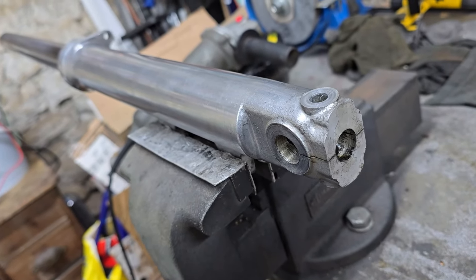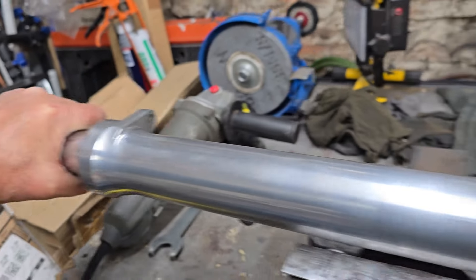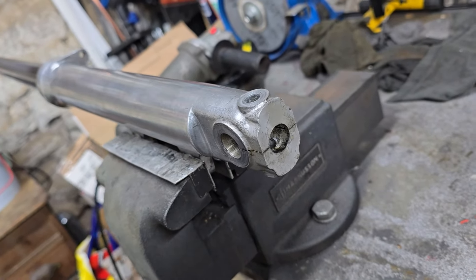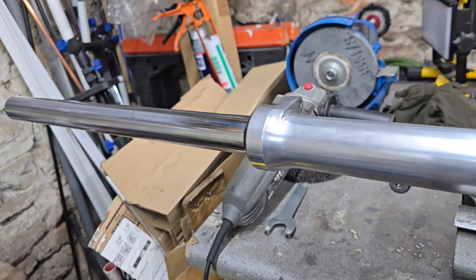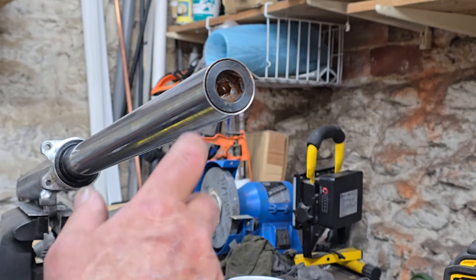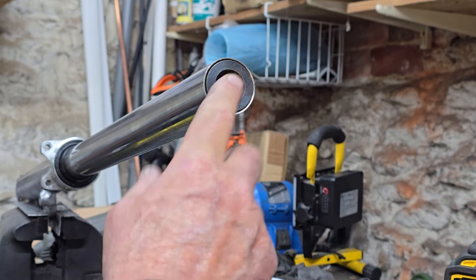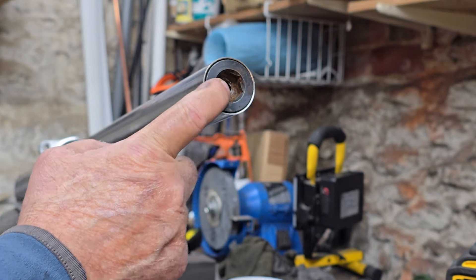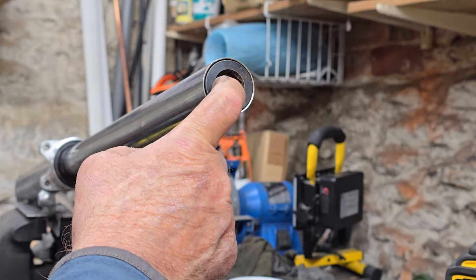In fact that's exactly what I've done with this one - I've just loosened those very slightly, which is why there's oil weeping out of them. I did have to hold the stanchion while doing it, but I used an impact wrench and luckily these ones came loose. I've turned the fork around and we'll take it from there. This was the hex cap I was talking about that I loosened off before unclamping the yokes, because sometimes these can be stupidly tight - which these were.